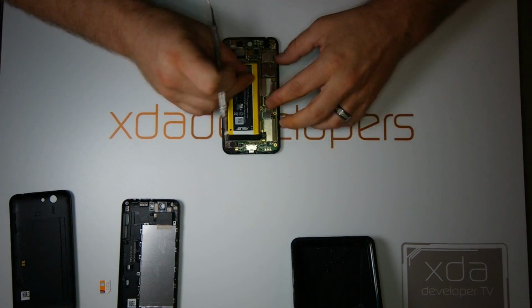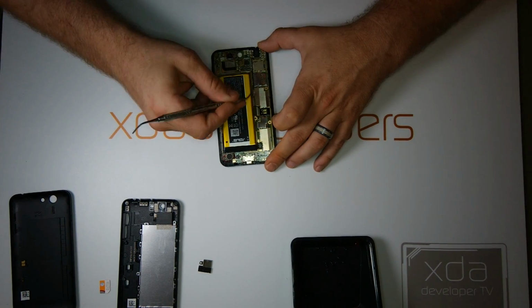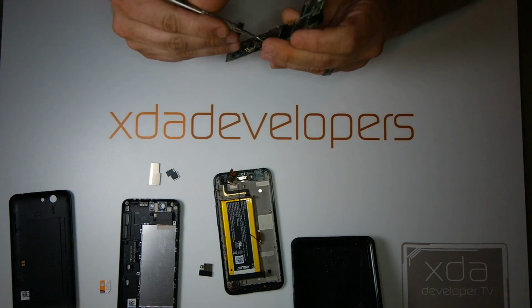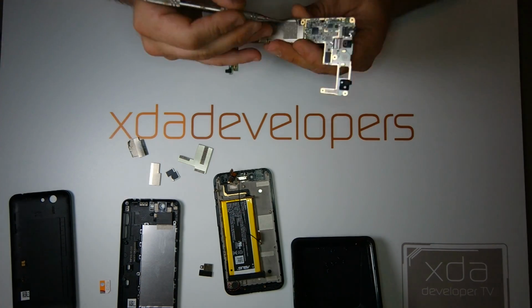There are no real gotchas to be noted, just a tab on the top of the battery which hooks the board to the device. Almost all of the EM shields are removable. The board uses the package-on-package design for its Snapdragon 800, and oddly, the eMMC is a separate chip, which isn't seen on many modern devices.